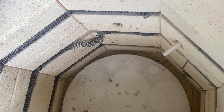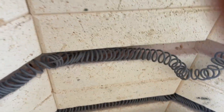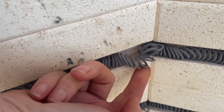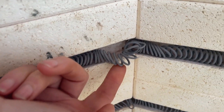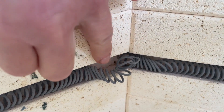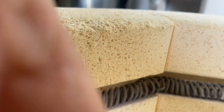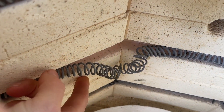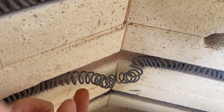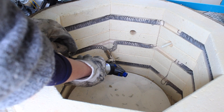Even though these look a bit gnarly, there's still loads of life left in them. So I want to bend these back into more like their original shape. The trouble is that when elements are cold, they are stiff and brittle. You won't be able to bend it back into the recess with a pair of pliers like you would with normal wire — it will just snap and then that's the end of your elements. So what you need to do is heat them up.